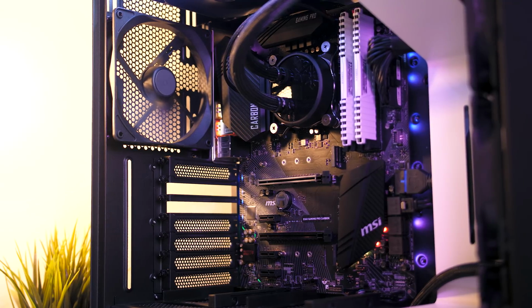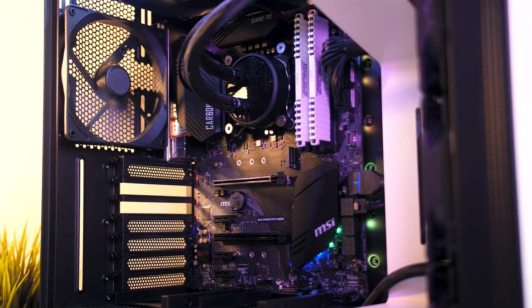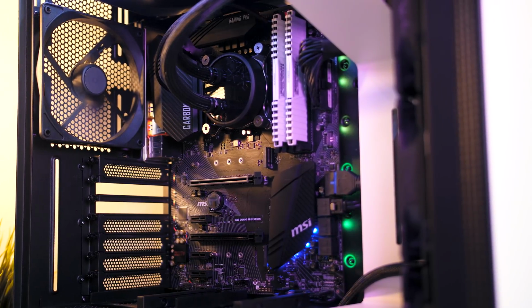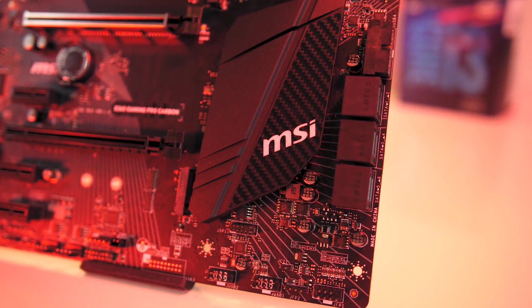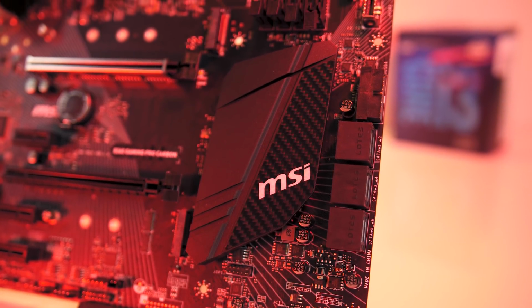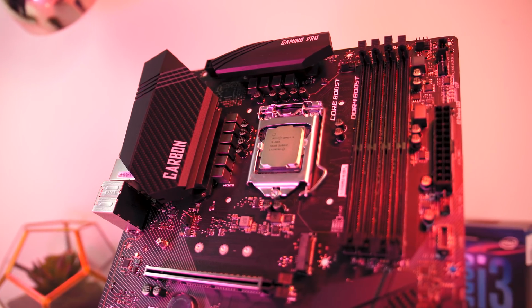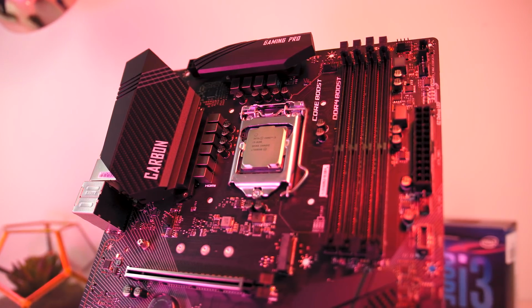Although Intel's 8th generation of CPUs launched a few months ago now, up until this point we've only been able to buy Z370 motherboards. While Z370 is required for overclocking K SKUs of Coffee Lake CPUs, it makes less sense if you want to buy a non-K CPU, like the i3-8100 that I've got here, as you're basically forced into buying a board with a high-end chipset.